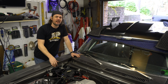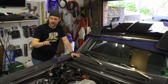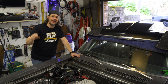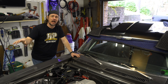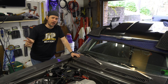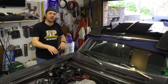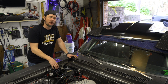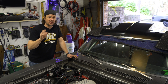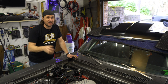What we are going to be doing here soon is utilizing this, tying into the new Snow Performance fuel pump control module. They've got a 3-relay potted module that came out that has nice terminals on it for hooking up and controlling a fuel pump. And I've been wanting to set up our surge tank where it's not running both pumps at the same time, but instead kicks on the second pump whenever our fuel pressure gets low on the fuel rail. And so we're going to be utilizing the CAN IO module and that Snow Performance fuel relay module to accomplish that. So keep your eyes peeled for that. We'll go over all of the programming, things like that. But for now, we're basically done for the Smoke Monster.